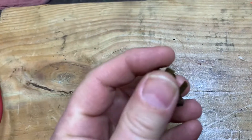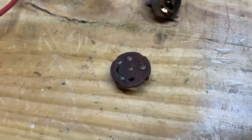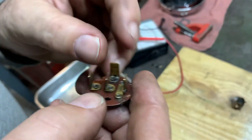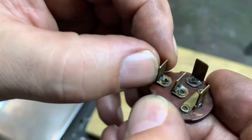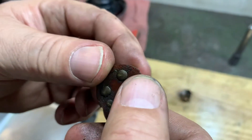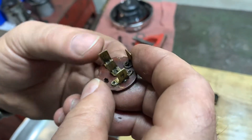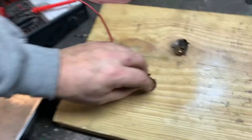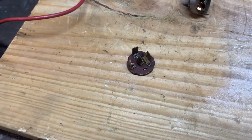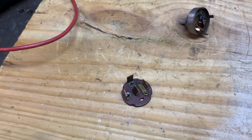I'm very grateful to have it. We'll probably have to make a little punch — yeah, a little concave punch to fix it. See, here's the problem: top of the rivet. Okay, so we'll have to make a little concave punch. Let's show the viewing audience what's loose and what's gonna break off. Yeah, that's gonna be intermittent — that's a problem. We got this far with this bike, let's make sure — let's put it back together properly. Alright, let me get a little punch made up. I'll pause this, we'll come back. Headlight switch — two point. Oh, I probably got a punch in here.